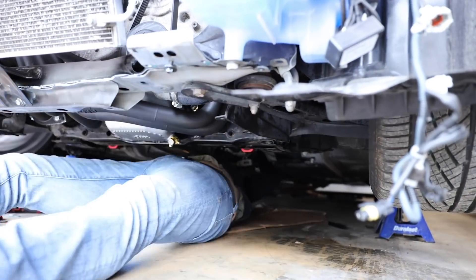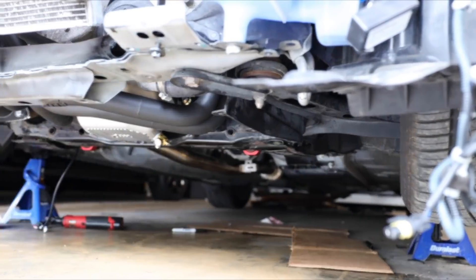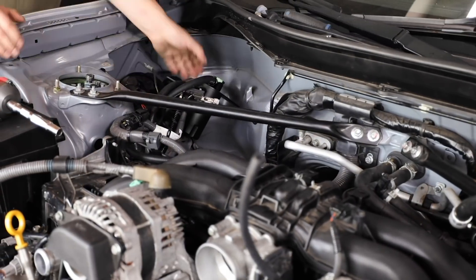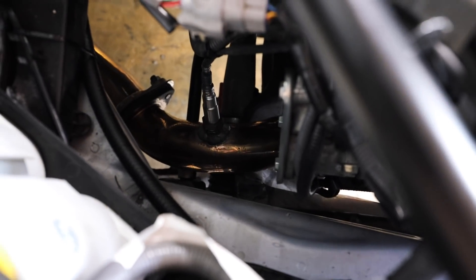The only thing I really have to put back in is the overpipe, get the O2 sensor put in for the AFR gauge, get the AFR gauge wiring tucked up out of the way. After I get the overpipe put in I'll show you guys how I ran the wiring for the gauges. Air fuel ratio gauge sensor is hooked up, exhaust is all plumbed back in. The sensor location on the overpipe couldn't have been in a more perfect spot — it's right on top as it goes over the subframe.